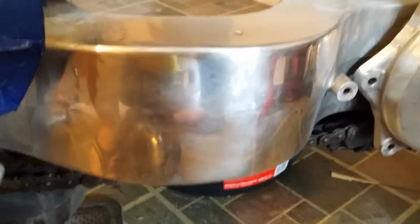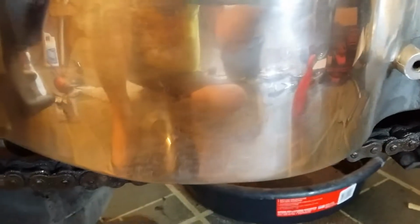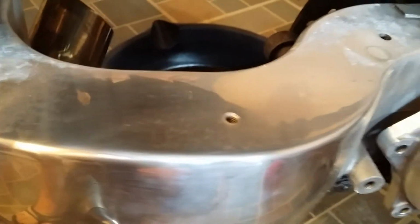Okay, here we are, about 2 minutes later. Just a little 2,000 wet sanding. And man, if you can go 2,500 or 3,000, definitely do it, because it saves a lot of time when it comes to polishing. So anyway, this thing acts funny, I don't know why it doesn't focus better than that. Something about when you get close to that stuff. So anyway, that's the sanding.